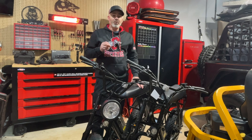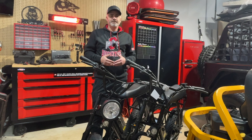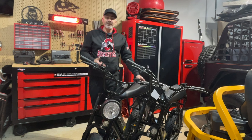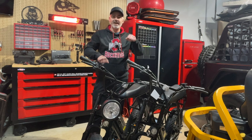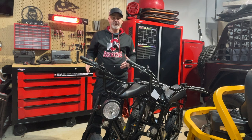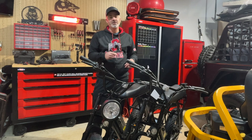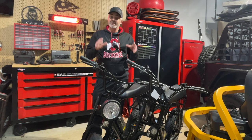The other way to unlock it, if the bike is manufactured and distributed in the United States, is with a magnet. There are other YouTube videos on how to do that. It takes a little more work but it basically tricks your back wheel from realizing it's going faster, because the magnet uses your pedals — as fast as your pedals are going is how it determines your speed. So you could throttle it and take off without pedaling. You'll need a strong magnet and will have to move a sensor component from the wheel to the pedal location.